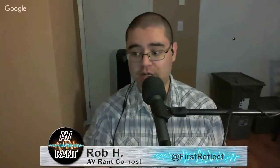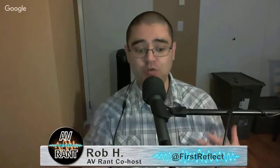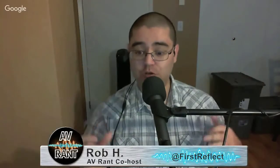He's got an SR5011, which can connect 7 speakers, and that's it. That's where it maxes out. Can't do 9, can't do 11, so he tops out at 7 speakers. Absolutely right. The front 3, fairly obvious. That's your front left, center, front right. But yes, the 2 speakers that are more or less directly over your couch and spread wide apart, those should be connected to your surround left and surround right binding posts.